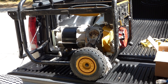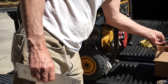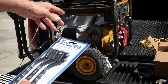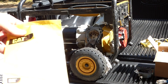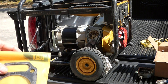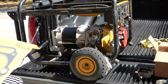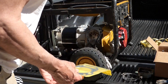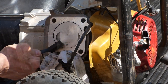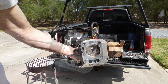I'm going to go through this quick — I'd like to clean up the top of the piston and the head. I'm going to use a brass brush, or maybe the nylon. You want to be real careful not to scratch it too much — steel is too abrasive. Got the new head gasket, a perfect match. Actually got this from the cat dealer for $4. If I ordered it online it was $16. So sometimes it pays to get local. Now we'll clean up the head — take it from this to this.